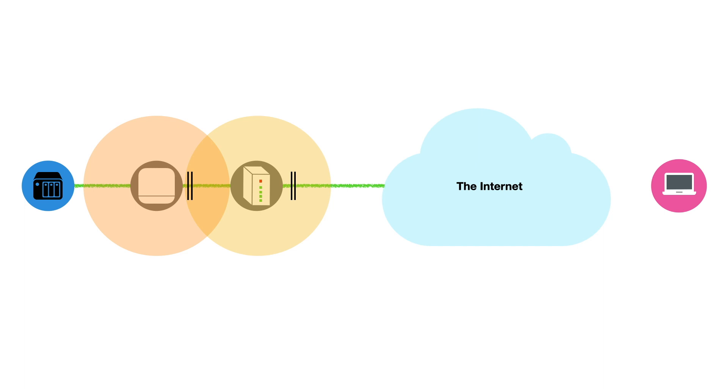While double NAT is a topic for a future video with multiple ways to fix it, our opinion is that the best option is to avoid double NAT in the first place. Not only will this mean you have one less problem to solve later, it will also make troubleshooting easier. So if you do have double NAT on your home network, before configuring your NAS it may be worth contacting your ISP, as they may be able to help you remove it.